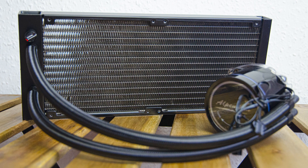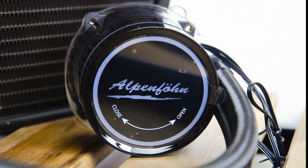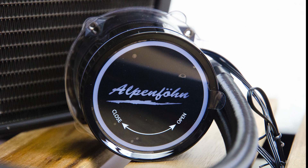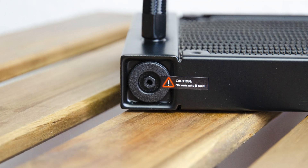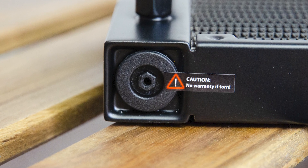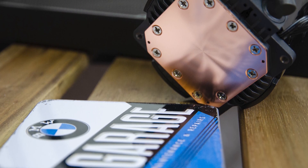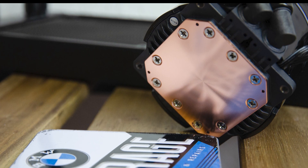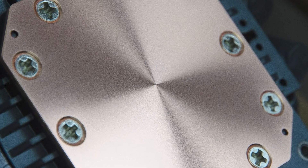Behold the all-sleek black radiator which is made from aluminium. The pump's operating range is between 1200 and 2600 RPM and it's powered via a 3-pin plug. This is the stock lid and the top film protector shows how to replace the plate by just rotating the top ring cap. One twist later you can now access the plate. The overall build quality is excellent with no flaws or unfinished areas. The diamond ground copper base plate of the pump possesses a large area of micro channels to dissipate the waste heat of the CPU into the cooling circuit quickly and efficiently. Zooming in, the finishing is very smooth and you can barely see the circular machining marks.